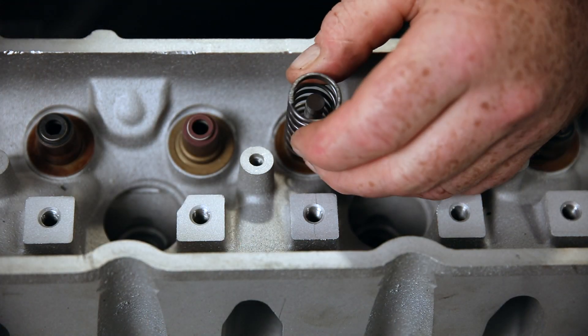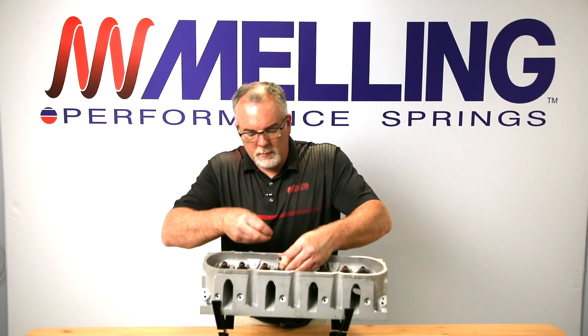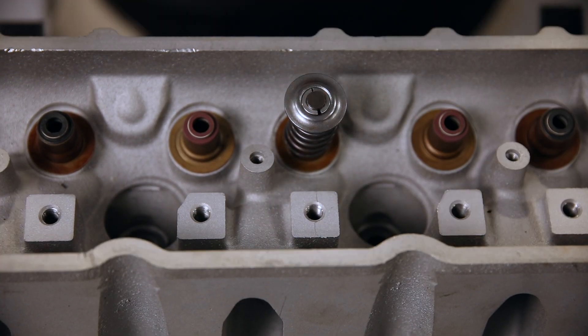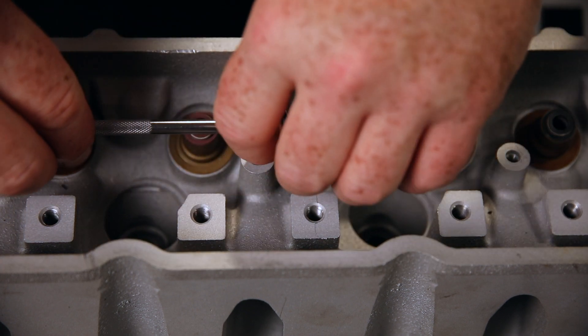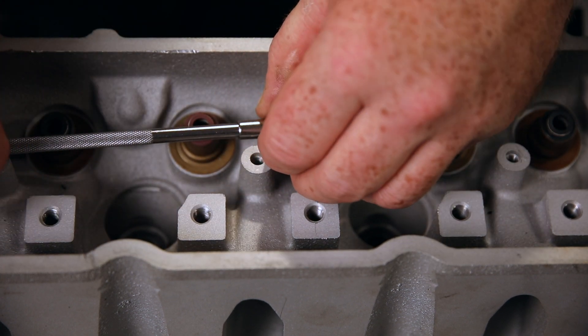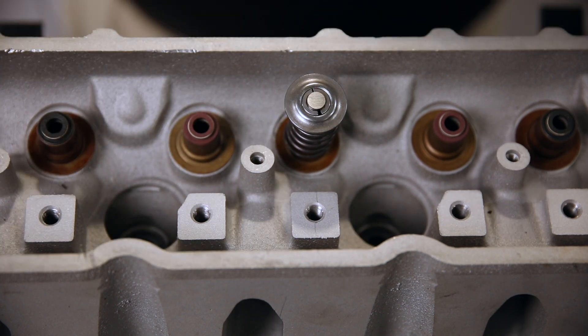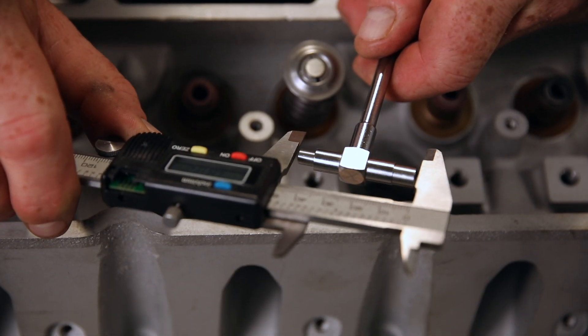To perform the next procedure, we will first install the valve seal, then place a low pressure spring on the valve seat, push it down and install the valve spring retainer and keepers. Next, we will place a telescoping bore gauge between the retainer and seat. Release the gauge, and with the gauge extended between the seat and the retainer, tighten the gauge lock and remove the gauge. Now we can measure the extended length of the gauge to determine the valve spring installed height.